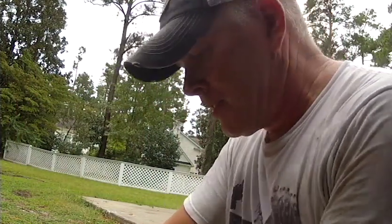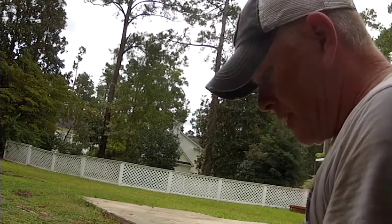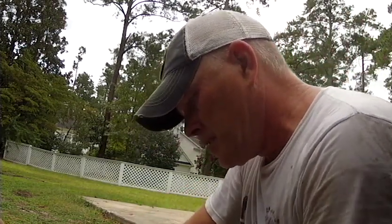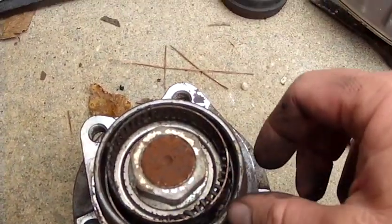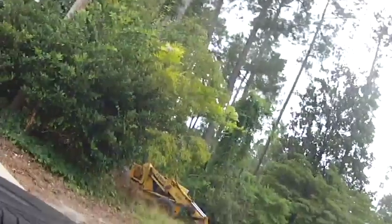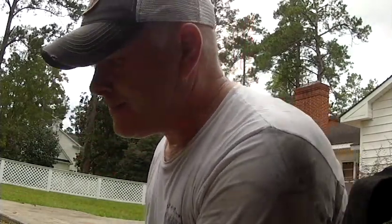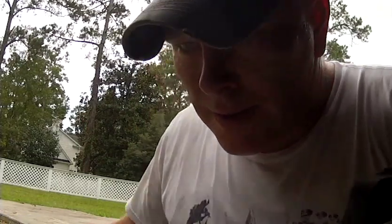Let me see here. This back popped off this thing while I was taking it off. Let me see if I can get it off real quick and show you inside. So, this is what the inside of one of these hubs looks like. You know, it's bolted together. And if you can see down in there, you can see there's bearings down there. And those bearings are what keep the thing moving. And those bearings go bad, and then it gets all loose. As bearings wear through, and the tolerances get larger inside there, they start making noise. Everything in there should be relatively tight.